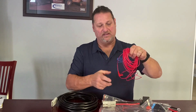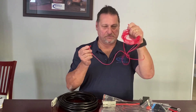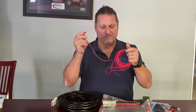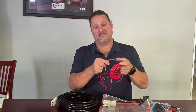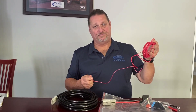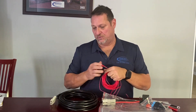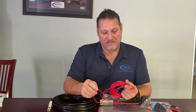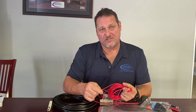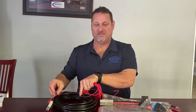We also put in a 10m cable with the little banana plug - make sure you pull the little plug out of it before use. It's advisable to connect this up to the ignition underneath the bonnet when you run this cable. Generally in your main fuse box under the bonnet you'll find an ignition circuit - just use the piggyback and go to the ignition circuit, connect this into there, and run it down to the back of the car.